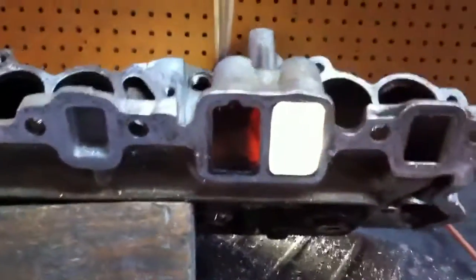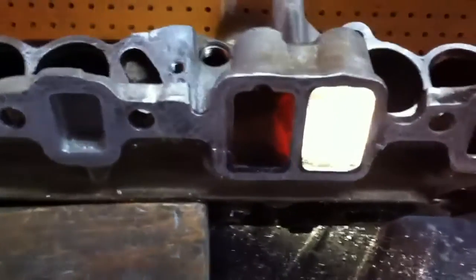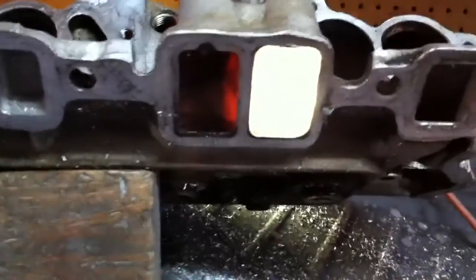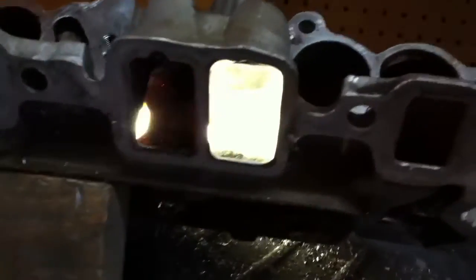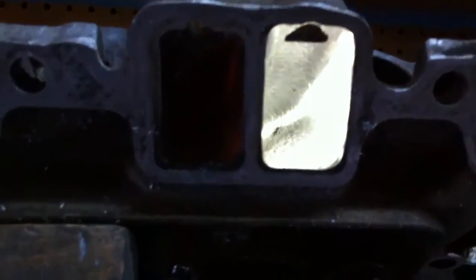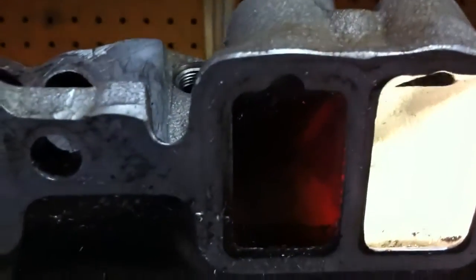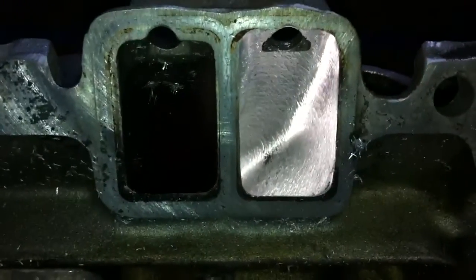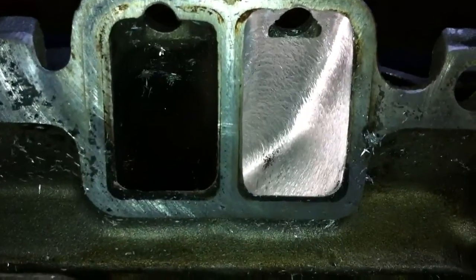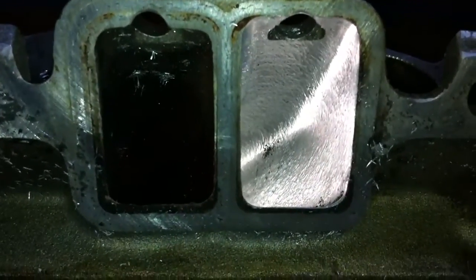Hi, this is Darren Dockerman with High Flow Fuel Injection and I'm going to show you some more porting secrets for the TPI lower intake manifold. This is a stock GM base and I started on one port. I've run the carbide through the entire length of the port and I'm getting ready to do the finish work on the port. Here you can see the difference in size and also the difference in shape — left is an unported port and right is ported. This one will be matching to a stock size intake gasket.